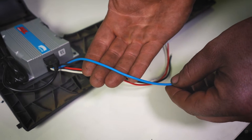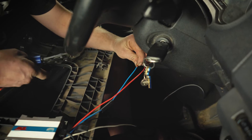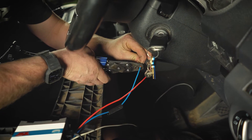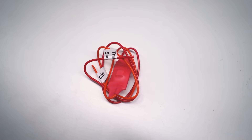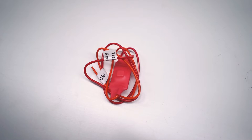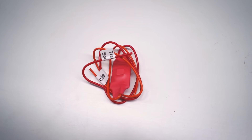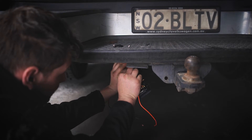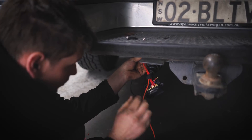And then you have your blue wire. This is your brake wire which communicates how braking force needs to be applied to the trailer brakes. This wire connects directly to the trailer brake wire, which will be pin 5 on your 7-pin trailer socket. For connections to vehicles with assisted safety systems, the protection blocking diode included in the kit needs to be fitted from within pin 6 with the other end wiring up to the brake pedal switch. If unsure if your vehicle requires this blocking diode, consult the vehicle's workshop manual.